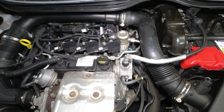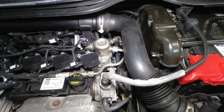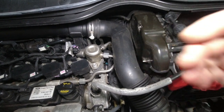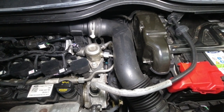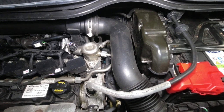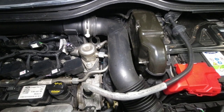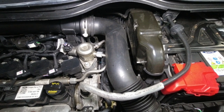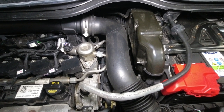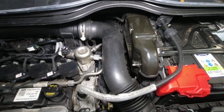So we're in the engine bay now. As you can see, this is the little three-cylinder one-litre engine. The multi-plug for the rear oxygen sensor, or the catalyst monitor sensor, is around the back here. I'm going to take this intake pipe off, do a quick resistance test of the heater circuit. Then I'll erase the fault codes and plug in a little test lead that I've made myself. We'll have the engine running and see the ECU command the heater circuit on — the bulb will light up — and we'll also see on the live data the command for the heater circuit to be switched on.